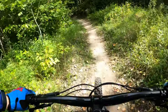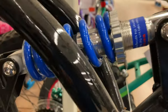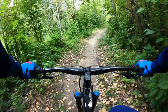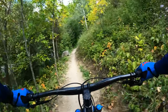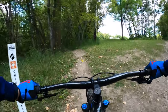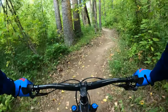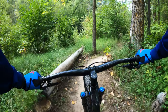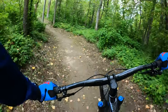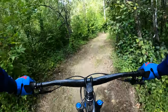The Marlin does not have rear suspension — it is a hardtail mountain bike. The Bear Mountain from Hyper Bikes does have rear suspension, but it's a unique suspension design. I don't think much efficiency has gone into it — I treat it more like a really heavy seat post suspension. You're not going to get much performance out of it. It is adjustable to a minor degree where you can add tension to the spring, but you're really just ramping up preload without much compression control. I'd call it a downside overall, except it does give a little more comfort going through a pothole.